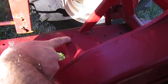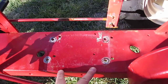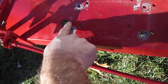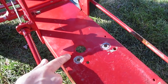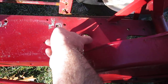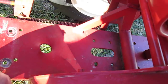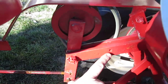There are a million holes in the frame, as you'd expect with any RJ35 — everybody goes drill happy. There are extra holes, and they obviously had a couple of different motors on it at one time. The original mounting holes look to be for a Clinton, confirmed by the offset drain hole. There's also no hole for the lift cable clamp, and the rear hitch itself is missing — I'll have to remanufacture all of that.